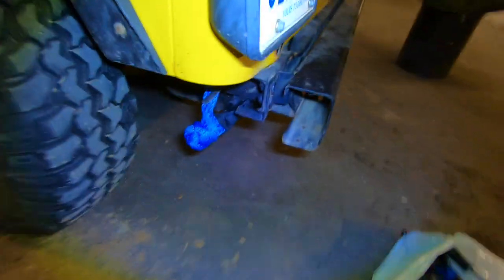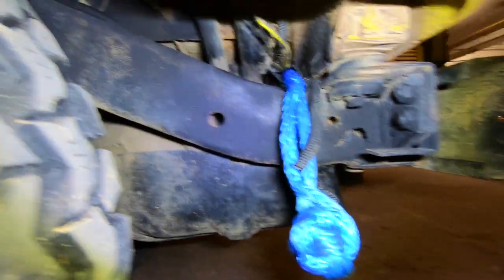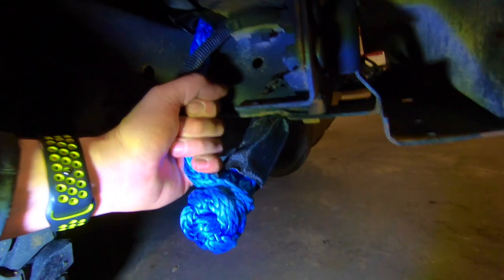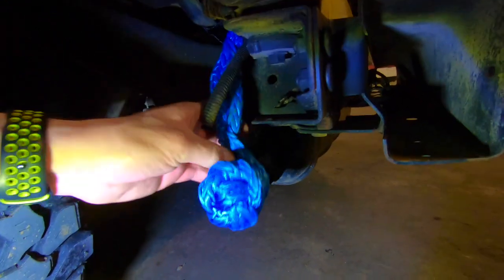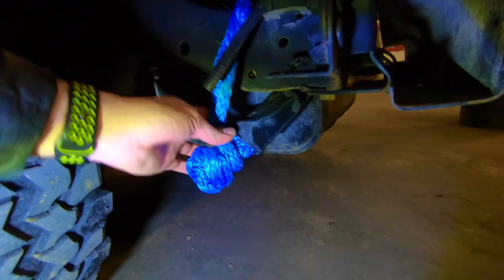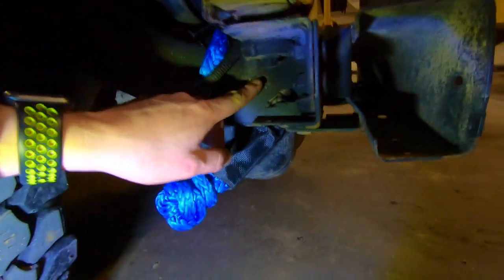My personal favorite reason I bought these — I don't have any tow hooks or anything in the back that I can use to get pulled out by. So what do you do? Soft shackle, right around the frame. As you can see, we're hooked right into the frame. We don't have to worry about anything that's going to bend or twist and we can get pulled right out. Look at all that room — I can almost get my entire hand through. You can add a tow strap, a hook, or whatever you need and pull yourself out. You can attach it literally anywhere you can loop it around, and you don't need to worry about getting a whole strap around it — because trust me, I've tried, and getting a strap in here is a lot harder than it looks.